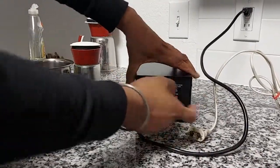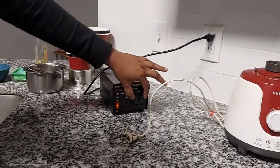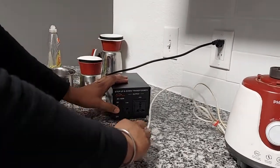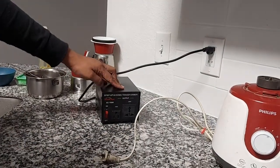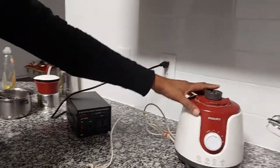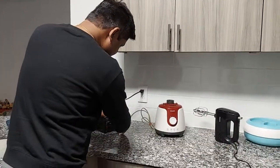So the input is 110 volts. Now if I switch it on, my output will be 220 volts over here, so I can connect any item that I was using in India. But make sure the wattage is matching — it should always be equal or higher. My mixer is 600 watts and this output is 750 watts, so it should be fine to use it.